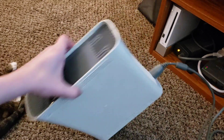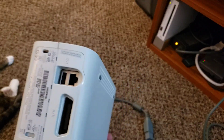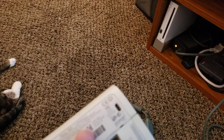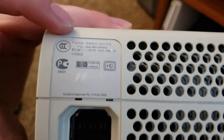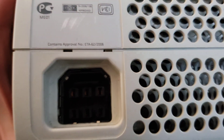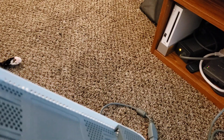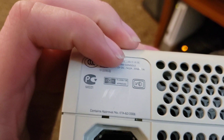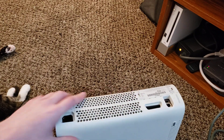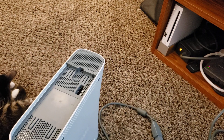What makes an Opus an Opus? If we look on the back of the Xbox 360 — first off, if your Xbox 360 does not have an HDMI port, then it is either an Opus or more likely a Xenon. You can check on yours by looking at the sticker: this machine uses 14.2 amps of power. The Xenon will have a pin on the power port, but a lot of times people break that pin off. If it runs on 14.2 amps and takes a Falcon power supply, that's how you know it's an Opus. If it does have HDMI and it's 14.2 amps, then it's just a Falcon.